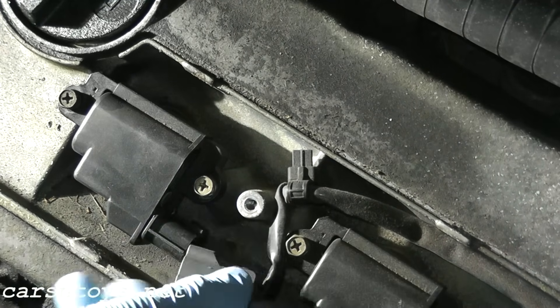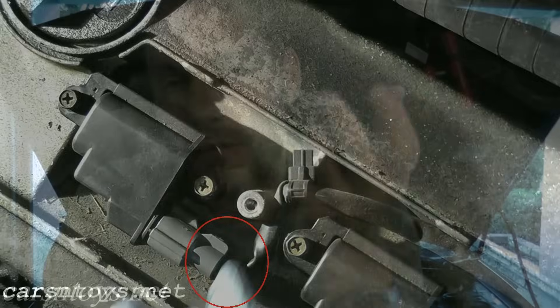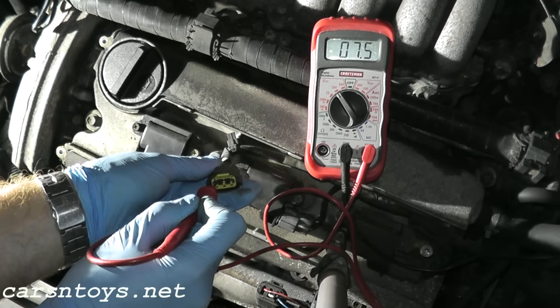Also, when you do the power balance test and disconnect the harness connector and nothing happens, make sure the harness connector is in good shape. Very rarely, those wires at the back of the harness connector can fray — maybe your car was in a barn and mice chewed the wires. I have a video showing how to test if power is getting to those harness connectors; I'll include a link below. It's for engine code P1320, and I show specifically how to test each harness connector. These are the steps to follow if your car is not running on all cylinders.